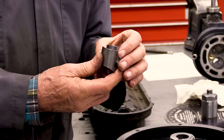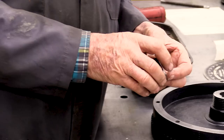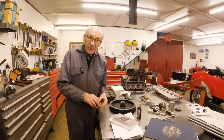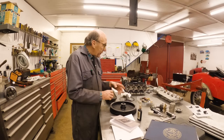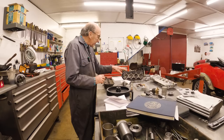And the camshafts that are in it, I bought from, ridiculous, can't think of his name. Comes to me in a minute. Anyway, it's got new camshafts. Mickey Hudson supplied the camshafts because he obviously had a few made. So it's got new cams, new cam followers, and the bit's been welded up with a laser beam. So that's the cam box. The cylinder head is a completely standard cylinder head. And we put the original valves back, and I think that's going to be good enough initially.